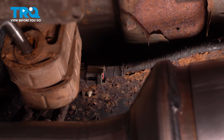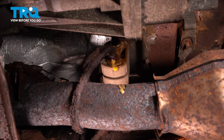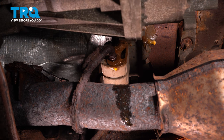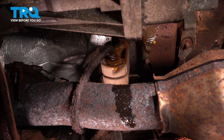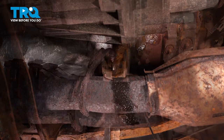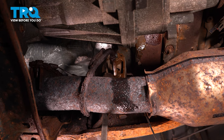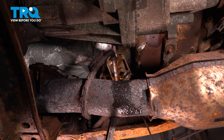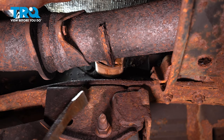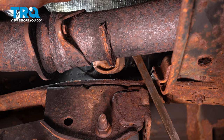I'm going to replace them, which is probably better anyway considering the condition of this exhaust. I'm going to spray some lubricant on this hanger — it's best if you use something silicone-based in order to not damage the rubber. However, really anything you have is better than nothing because these are difficult to get off. I'll take a pry bar and try to pry the rubber off of the bottom hanger. There's one more double hanger towards the front, and the hanger at the front is just a single hanger — pry from the backside, from the rear of the truck. That seems to be a better area to pry from.